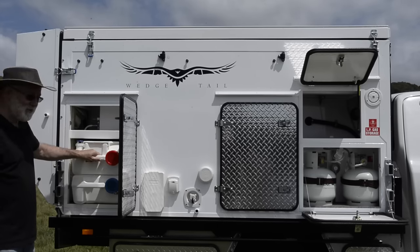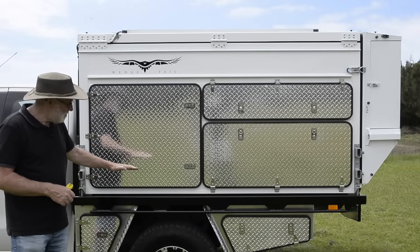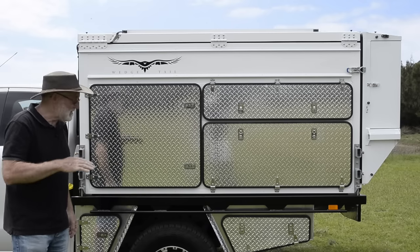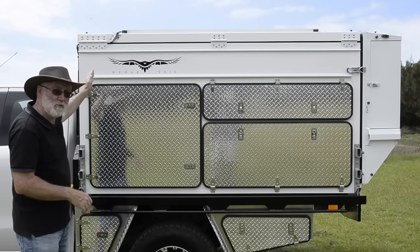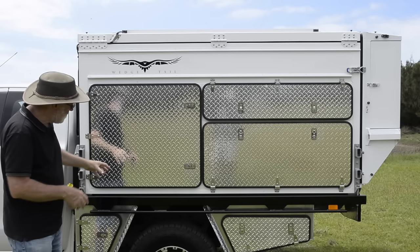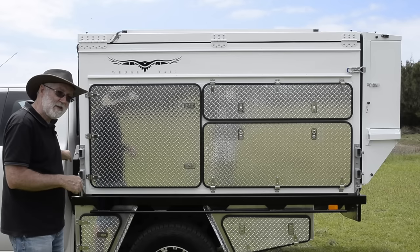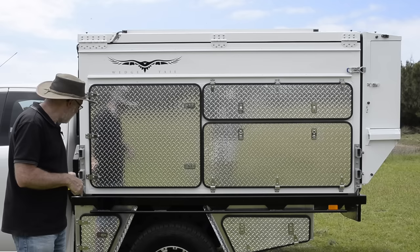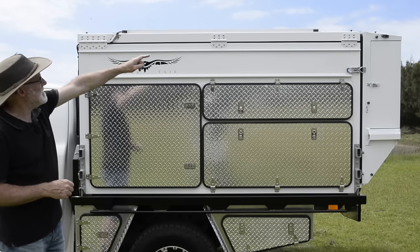This gives us access to our toilet. On the passenger side — this is a raised vehicle but the tray is relatively low, which helps with side slope performance and keeps the camper behind the cab for reduced wind resistance. However, flat trays can have problems with back-surging fuel, so we've redesigned the fuel inlet so you can use a high-flow filler at a truck stop without back surge.